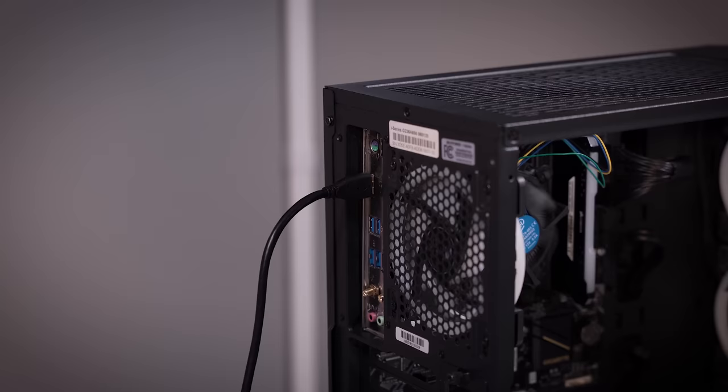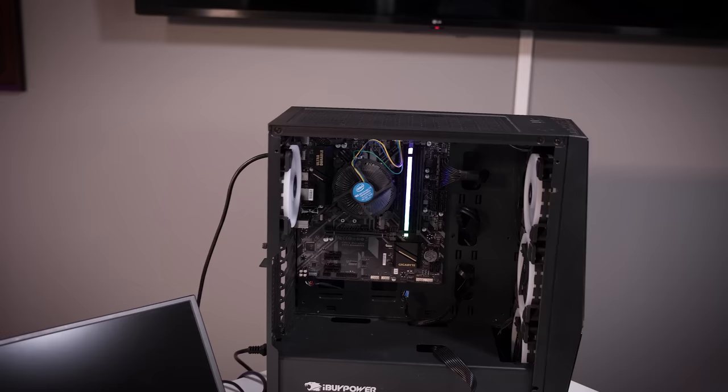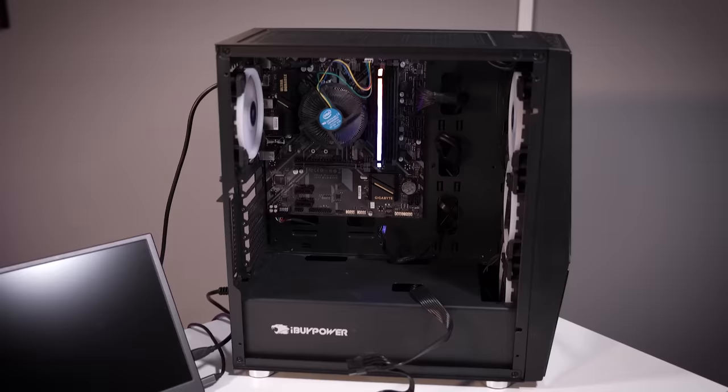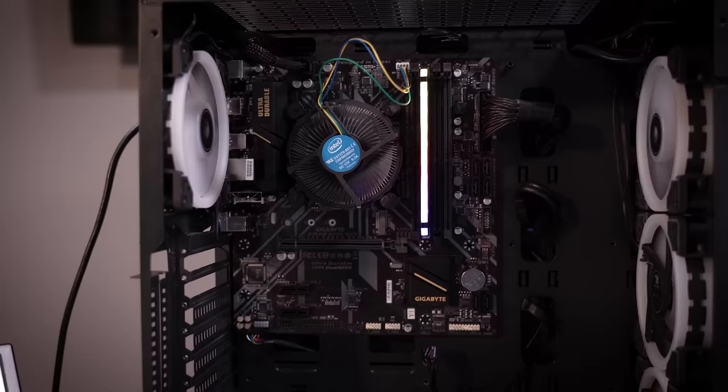We also just tested running off of integrated graphics by plugging the HDMI cable directly into the motherboard to run off the CPU's IGP — if it has one. I'm not sure if it's an F SKU or not, but we still get nothing. Off camera I also disconnected all non-vitals including HD audio at the rear, the front panel — which we've seen cause issues before — disconnected RGB cables, etc. Only the 24-pin and the 8-pin EPS are connected to the platform at this point, and we're still out of luck.